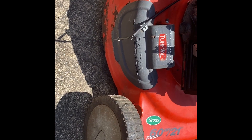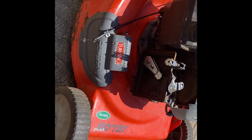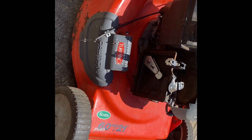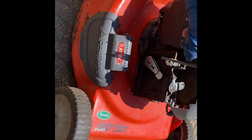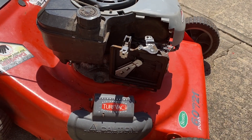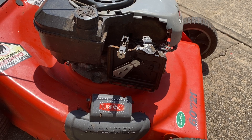I'm going to clean this up, put a new air filter in, put a new pull cord in, change the oil, and sharpen the blade. I may not film all of those steps. This was just an interesting setup - how the priming system worked. I'll also remove this broken cable. I put some used fuel line on it - it may be vacuum line, I'm not sure, but I'll go to the auto parts store and grab a couple feet of the proper fuel line.